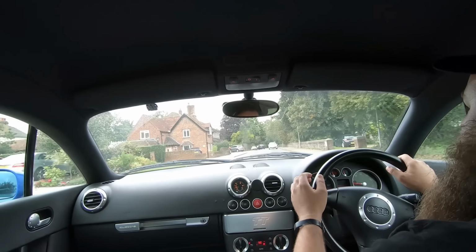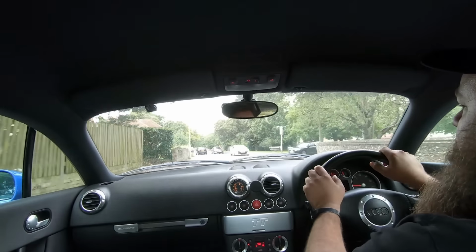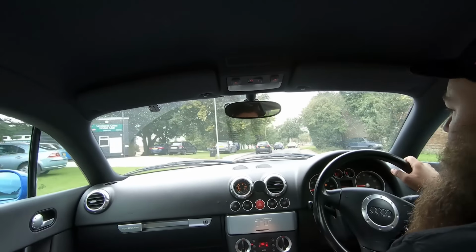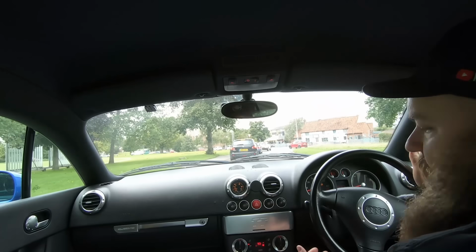Main faults are your clutches, and hesitating while boosting. Another good one is when on idle, if you've got a boost gauge, you should get about negative 15 or negative 20. That's the vacuum being pulled by the engine, so you'll know you've not got too much of a boost leak issue there. So, like I said, just get a good feel for it.